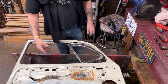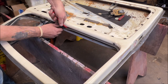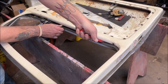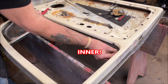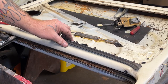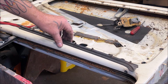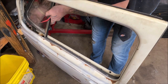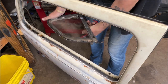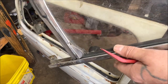Now we're going to take the window scrapers out. Let me bring the camera around — use a plastic pry tool for those with nice paint. You're going to pop the clips off. This is the outer scraper. The new factory clips don't seem to hold as well, so you may need to adjust the new ones a little bit. When I got the outer scraper off, it came out a lot easier.